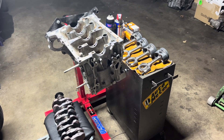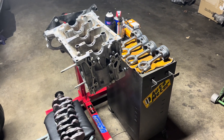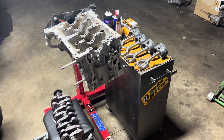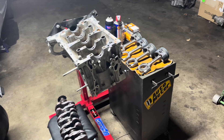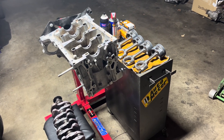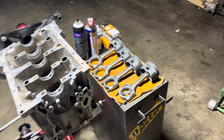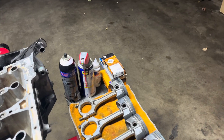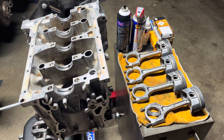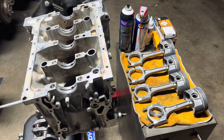What up YouTube, so today is going to be part four of the K24 K20 EK K2 turbo all-wheel drive build. Today we're going to be getting the bottom end assembled - we're taking pretty much some TSX pistons. If you haven't watched the last video, we put in new rod bearings, piston rings, and we got our crank micro-polished, pretty much getting everything ready.